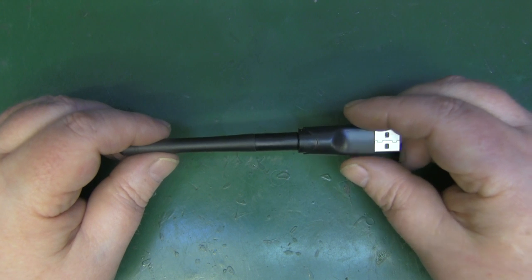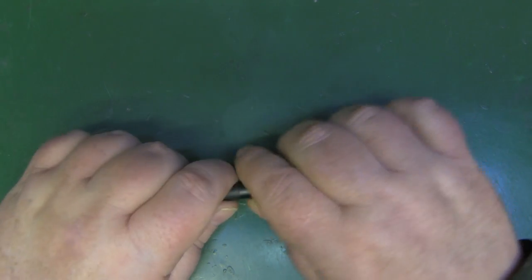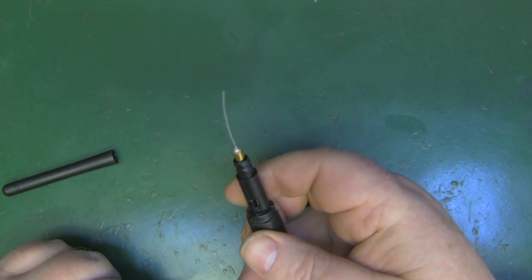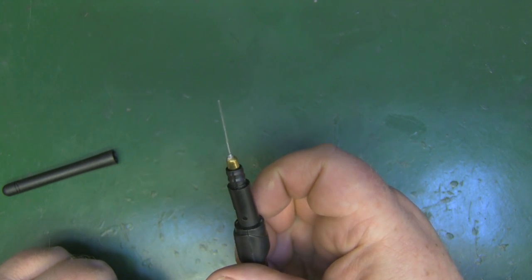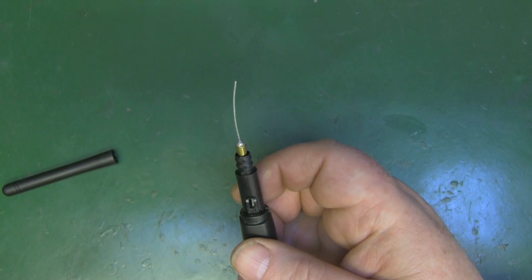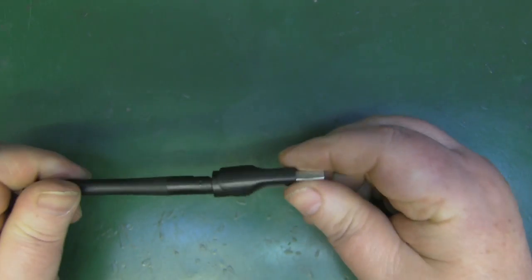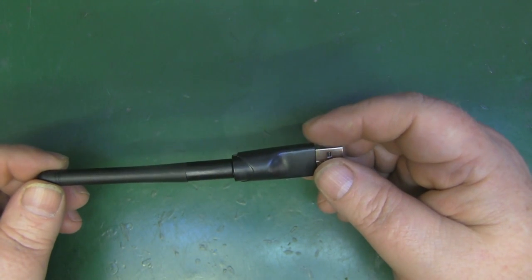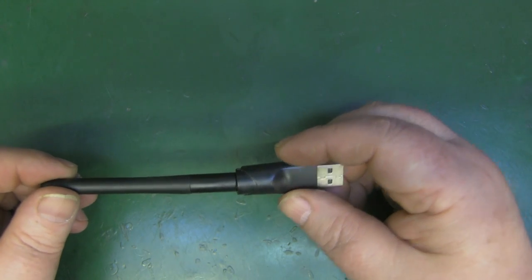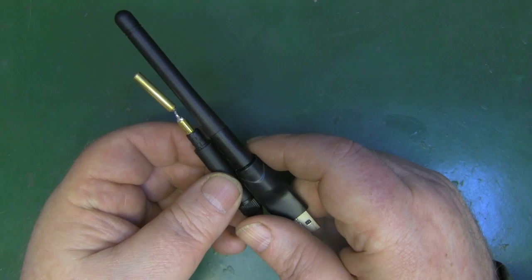Finally, I've got a cheap dual 2.4GHz and 5GHz Wi-Fi adapter here that doesn't work very well at 5GHz. If I pop this open, you can see why — it's just a 2.4GHz dipole antenna inside, so it isn't tuned for 5GHz. You get what you pay for. It's a nice example of why some people are disappointed — 5GHz Wi-Fi is faster because you can get more data down the line, but these cheap adapters aren't going to the expense of including a proper dual-band antenna.